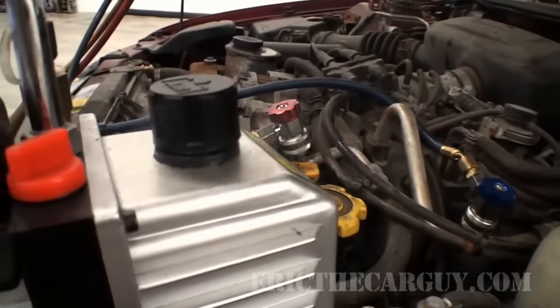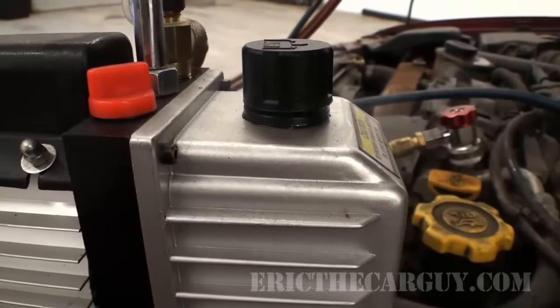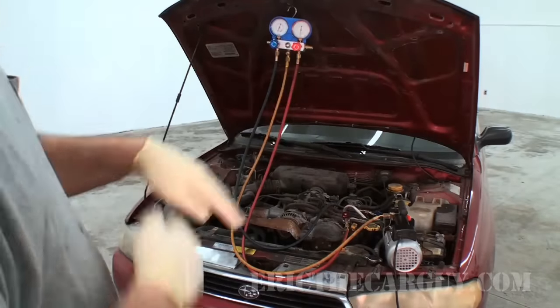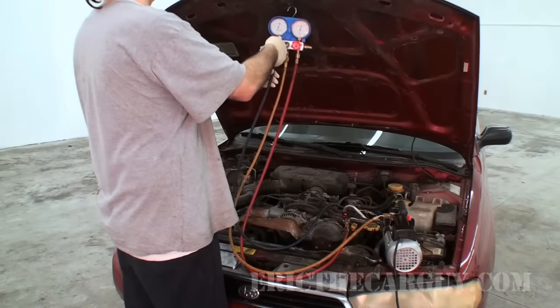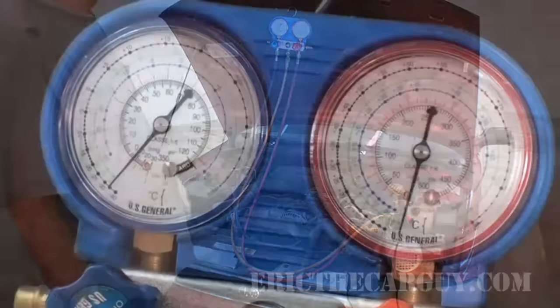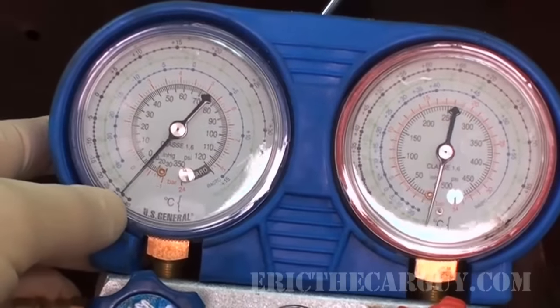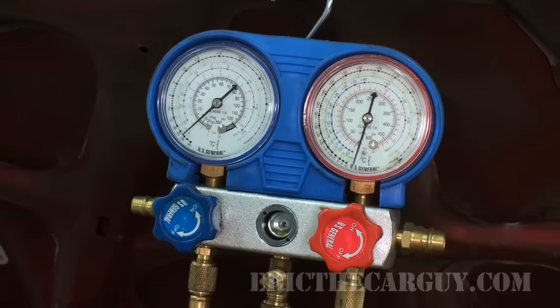You might actually be able to see this — that's the moisture boiling away, just like you'd see a pot of boiling water. It's been about 25 minutes, so I'm going to close my gauges, turn off my pump, and let it sit. Right now you can actually see that the gauge is dropping fairly rapidly, which probably means there's a leak somewhere in the system. Knowing I need to put a receiver dryer on this anyway, I just wanted to see if I could hold pressure. My repair is likely junk, so I'll probably get that low pressure line in addition to a receiver dryer.